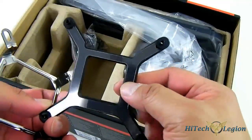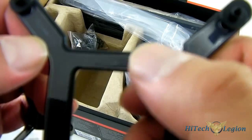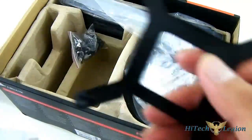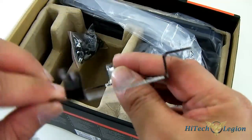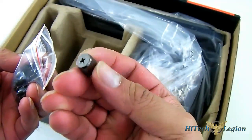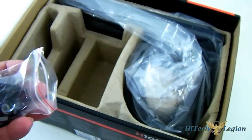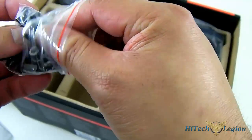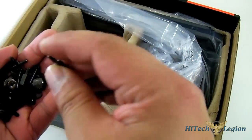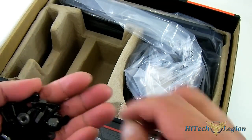And the back plate for Intel — there's a small label for LGA 1366, LGA 1155, and LGA 1156 size differences. You simply slide those connectors and use the magnetic Intel bracket. There's a bag of screws containing thumb screw locks for locking the bracket to the back plate. These two clasps are for the AMD lockdown mechanism. You have stand-offs — two different kinds for Intel. The ones with one short end and one long end are for LGA 2011 systems, since they have an integrated locking mechanism and don't require a back plate.